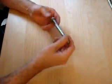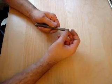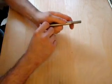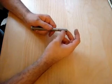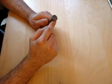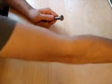Alright, so what's nice about the TAB tabs is that the threaded end is actually tapered down a little bit. The head of the bolt is 19 millimeters. This end is 18 millimeters. So when you go to reinsert it in the trailing arm, it doesn't have to be an exact science. You've got a little room to play with because it's a little bit narrower. The head of the bolt is not your standard hexagon, so if you try to use a 19 millimeter socket that's a hexagon shape, it's not going to work.